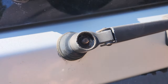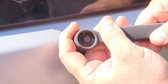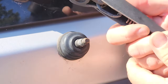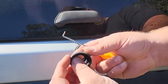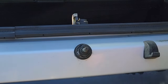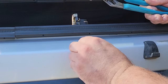Just gonna lay this closed for the time being. We can access our 13 millimeter screw in here. Pop on the 13 mil, take off the nut, and hopefully we can wiggle this off. It'd be a shame to have to employ a puller — usually they just kind of come on out. There we go, they're not pressed in too hard. Pop off this little cap — it's plastic, don't break it. Most of them start to crack so no biggie. I think I have my wrench in here — got an adjustable. Nice easy access with the hatch up.